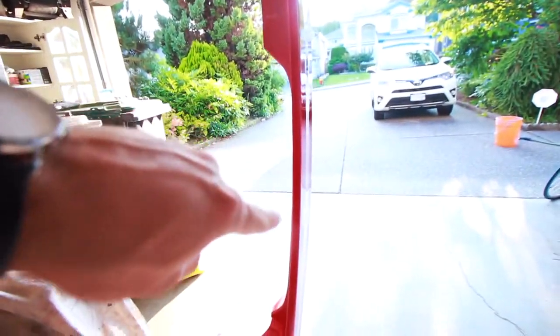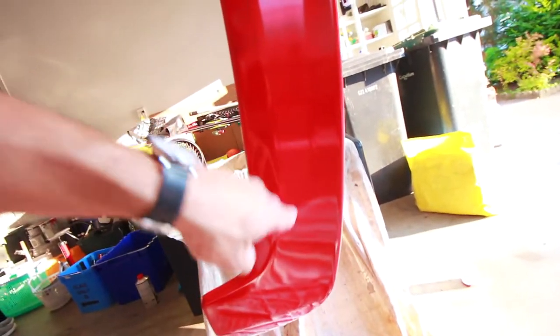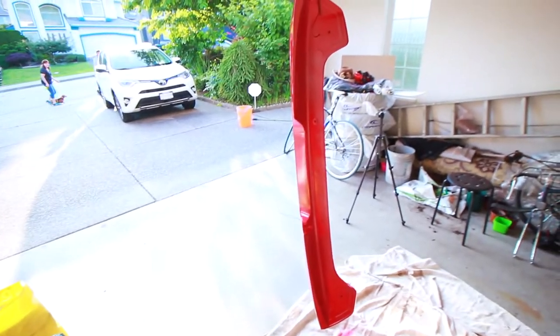Just finished the third and final coat and it's looking pretty slick. It's not perfect by any means — there's a drip mark in this area, a little kind of dent mark, and a scratch that I missed unfortunately — but it is what it is. For the most part it looks pretty good, I'm happy with it, and once it's moving on the car no one's gonna notice the imperfections. Before I mount it I have to wait at least 24 hours, because if I try and mount it now I'll get fingerprints and scratches since the paint is so soft. I'll see you when it's ready to be mounted.